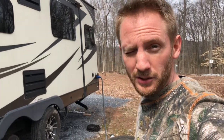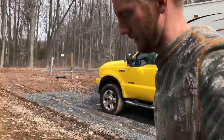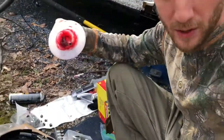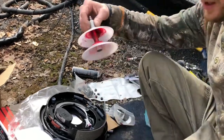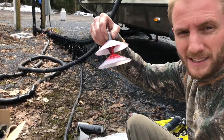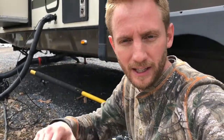Now, a good thing to know — I told you it cost about $225 to replace everything, and that also included the tools I needed to do it. One of those tools is this little grease press here. You put your bearings in here and it basically packs the bearings for you with new grease — seven bucks, 100% worth it. You can't just try to push the grease in; you've got to really force it through, and you'll see that later in the video.